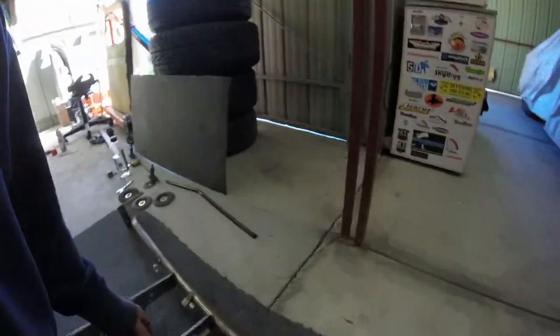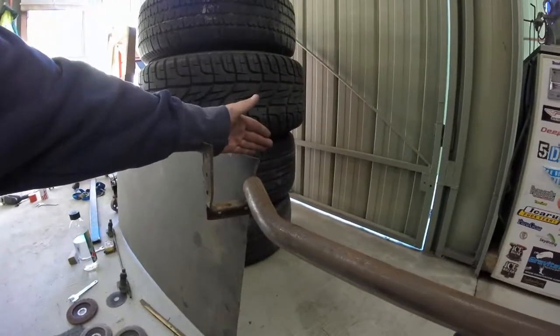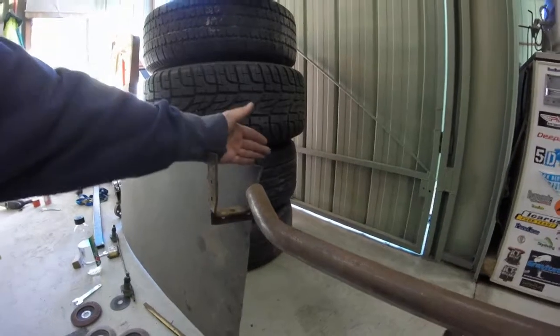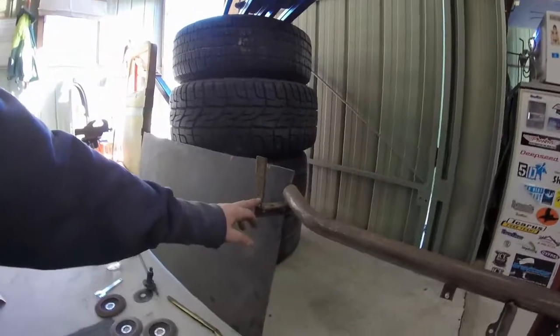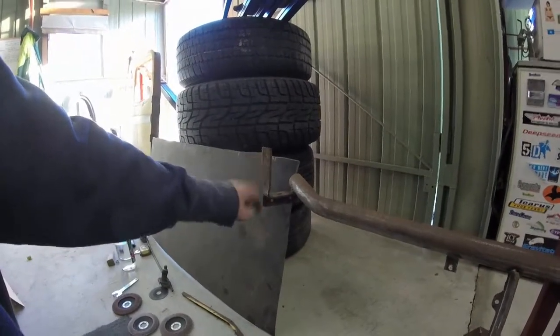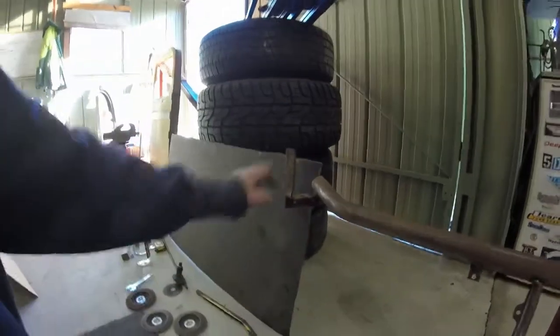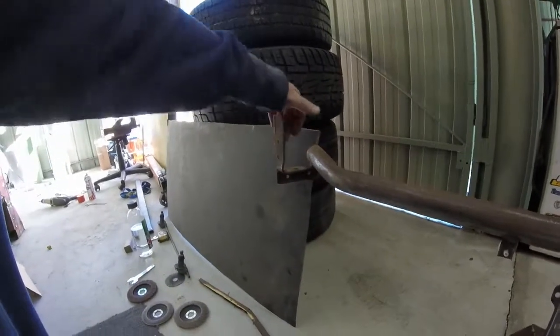Okay, this is it here. As you can see, it's pretty much exactly the way it came out of the Festiva. I did have to chop the ends off here a little bit — they were a little bit too long, and they had plates on them which weren't going to work for my application. These brackets — I've got one on each side — these are original Studebaker floor brackets. I ended up using these because they work perfect for the application. It gave me a point in which I could put bolts through into the solid dashboard mount.